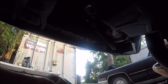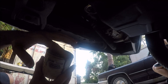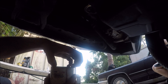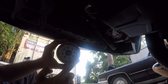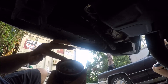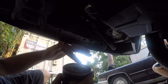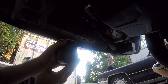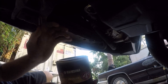Here's our filter. Always make sure that the black rubber gasket comes off with it. If it's not there, check up where the filter screws on — you need to make sure that gasket comes off, otherwise you won't get a proper seal with your new filter. Here we have our new filter complete with a new rubber gasket. Take a dot of oil and rub it along the new gasket so it doesn't dry to the engine and make it hard to get off next time, and it'll help create a nice proper seal. You could fill the filter with oil ahead of time, but I think that leads to more mess than good — once you turn the engine, it'll fill the filter by itself anyway.